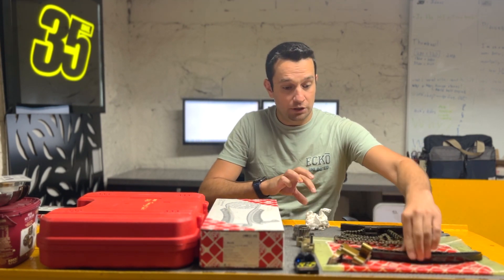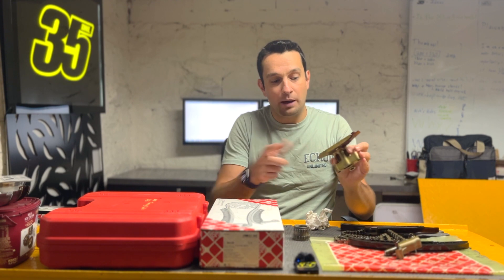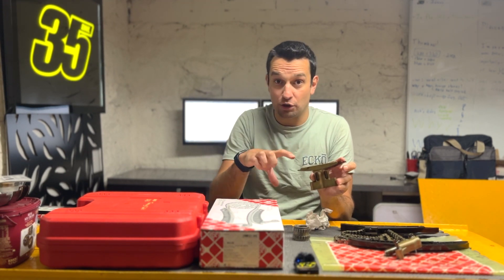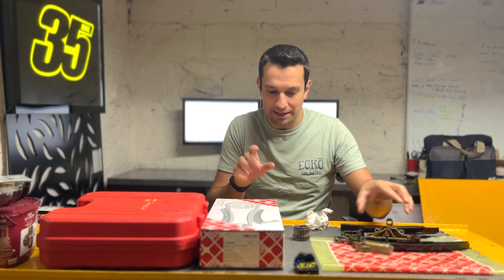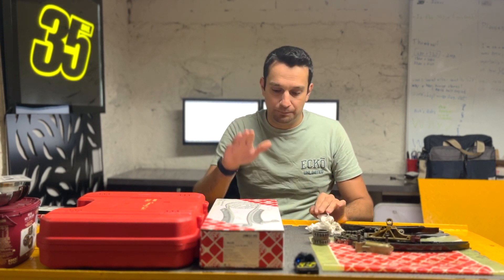Inside the kit you'll also have the main guides, the side guides, the hydraulic tensioner, and the top tensioner — some people call it the top rail or top guide. This top piece is not really guiding the chain anywhere; it's just pressing the chain a little bit between the two sprockets. I want to make very clear that this kit does not come with the lower crankshaft sprockets, and it does not come with the lower chain guide. Those two things you'll need to buy separately.